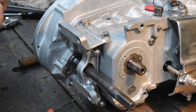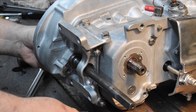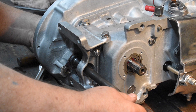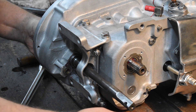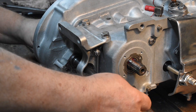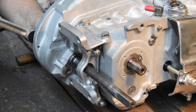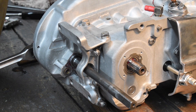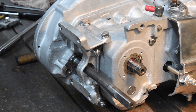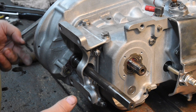Get your big nut, put your lock plate on. Make sure your slide and your shaft are correctly oriented. Use the wrench that fits it — don't use a hammer and a chisel. When the kickstarter hits the stop, the kickstart arm should be straight up. I use the pin in the crankcase as the stop pin for locking in place when I tighten the nut. Get it good and tight. It should rotate freely when you're done — if it doesn't rotate, figure out what you did wrong and fix it.